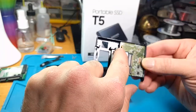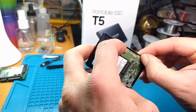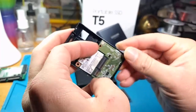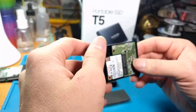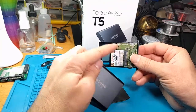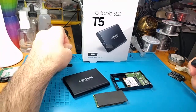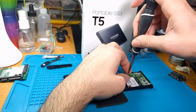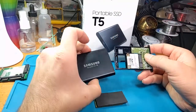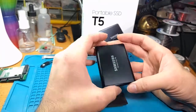When you're taking this out — this is actually the hardest part — there's a single screw here, and you just gently lift the sides. Gently lift up over on this part of the PCB; try not to lift it up by the hard drive, because that's the important part. You'll see it just unclipped, and then you can wiggle it and pull it out that way. I'm putting this back together, doing it in the reverse order, so there'll be that one screw, and it slides in like so.